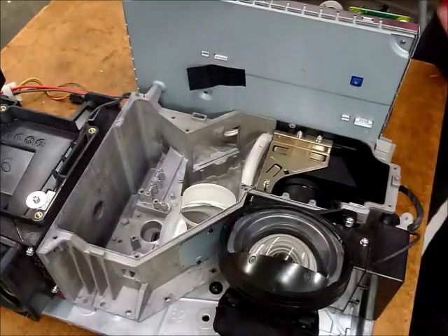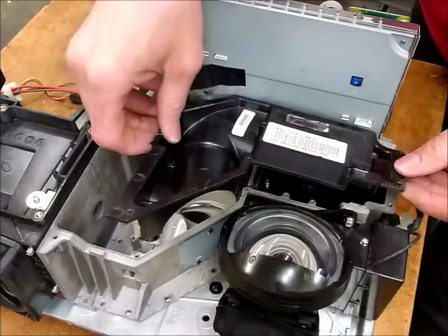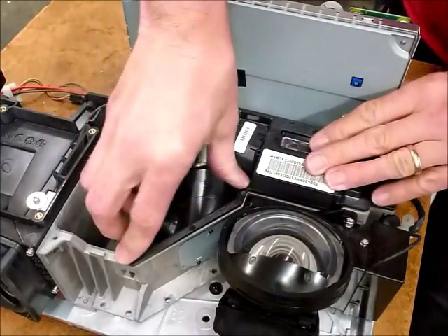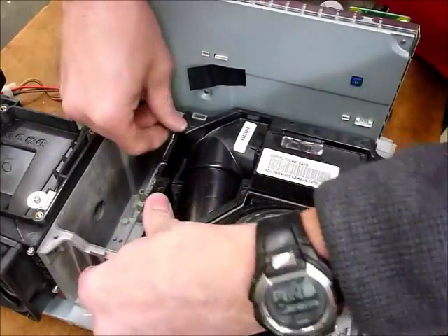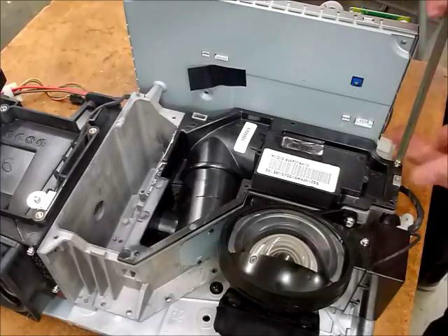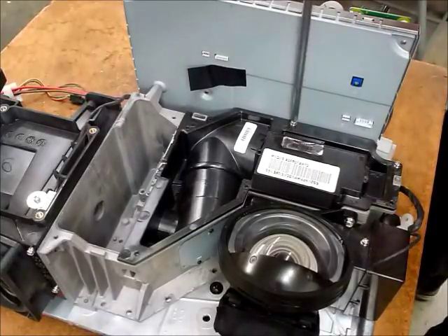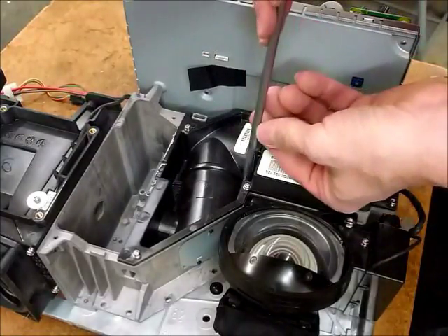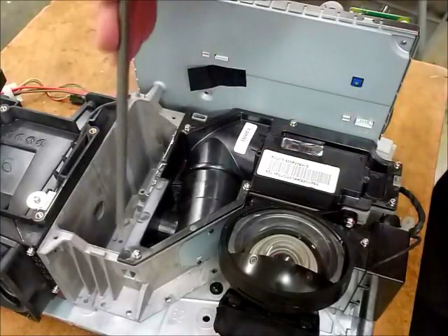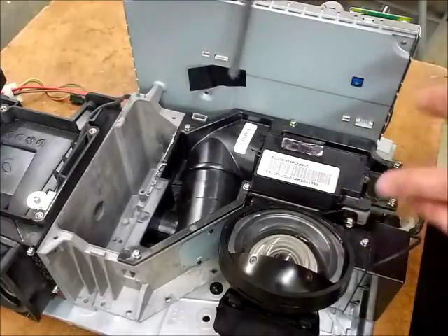I've cleaned the lenses and cleaned the mirrors inside — everything's all ready. I suggest blowing out with compressed air before you start to reassemble at all. Make sure it fits and goes down snugly — it may require just a little bit of pressure but not too much. Remember we had this screw and this screw with little wire retainers on them. I'll go around and put all the exterior screws in first. Everything's snugged up. If the center screw, after you've put all the exterior screws in, feels like you're tightening it forever, double-check to make sure all the lenses are fit back in the little retainers and that none of them popped out at an angle.